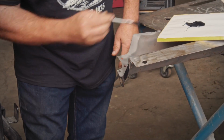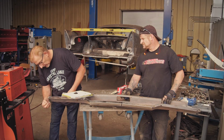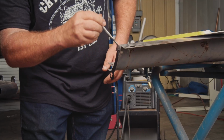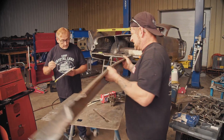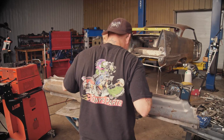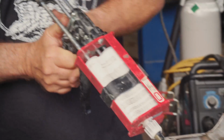You have to have clean metal, and it's got to have good grooves in it, and it's got to have a little bit of etching, so that grinding of the 80 grit I had you do will take care of that scuffing. So that's nice and thick there. Nothing you want to get on your hands, huh? Well, if you get it off while it's soft, it's fine. If you wait till later, you're not getting it off. You have to sand it off.